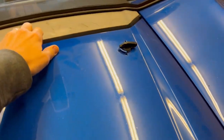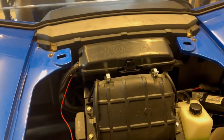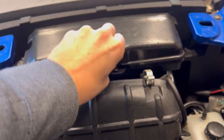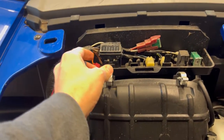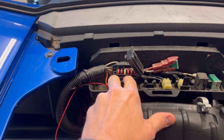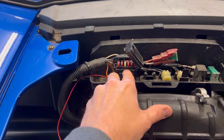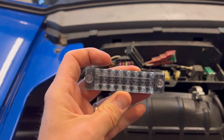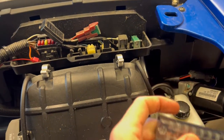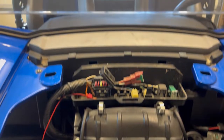The next step will be electrical. Now that I've talked about the mechanical side I'll go to the electrical side. There's a fuse panel, and inside here are the titles for all of these. I'm going to look for a point that is on with the ignition on only — not all-the-time power — because I don't want these lights on all the time; I only want it with the ignition on so I don't kill the battery. Then I need to find a spot to mount the terminal block somewhere tucked up out of the way, not with a lot of moisture, and I'll gang all the switches off of this one terminal block and run it throughout the rest of the side-by-side.